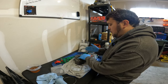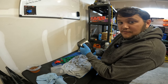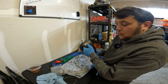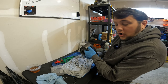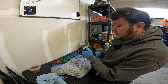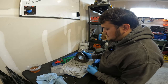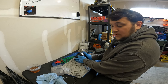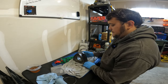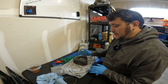We have found our very front rotor. Since I had to buy multiple new rotors and get everything machined, we're going to look at the faces of the rotor — they're going to say FB, FD, FE, FA. That's a side of the motor, front or rear (F or R), and then a weight: A, B, C, D, E, I think all the way down to G. Mine says FC — this is a front rotor, C weighted. I'm going to orient it with the gear, which goes on the outside of the engine, to my left. We are working on the front most face of all the rotors — the front face of the front rotor.